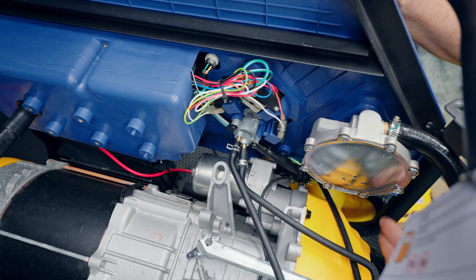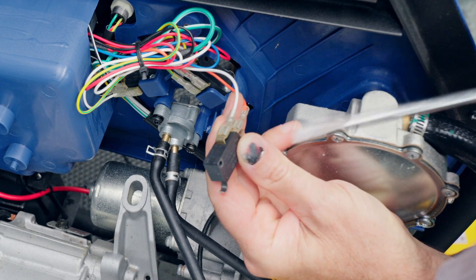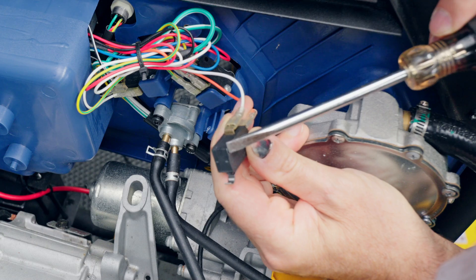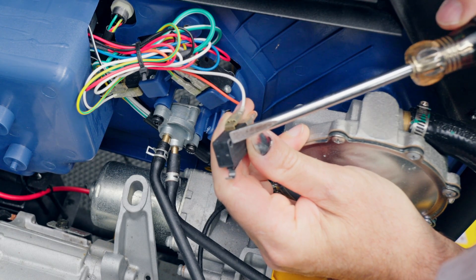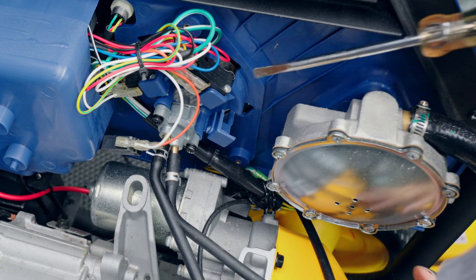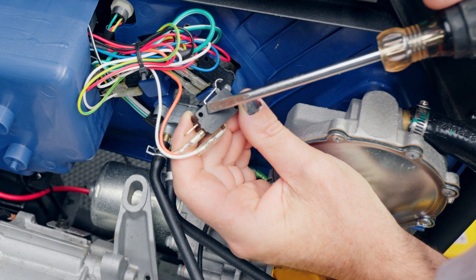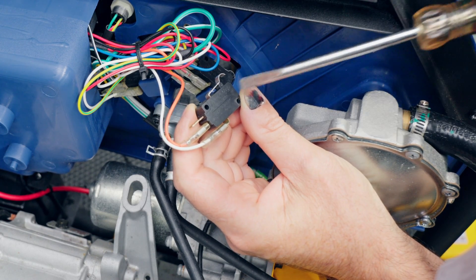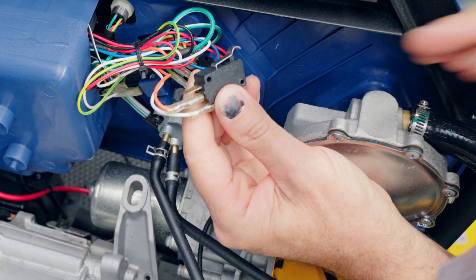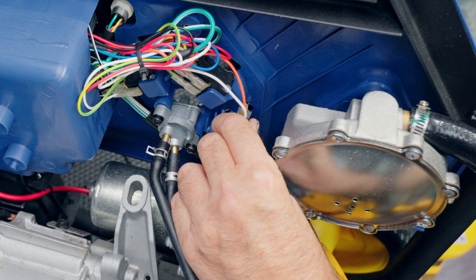This is kind of a flimsy design. Here's the problem — the switch came loose. It's held on by a screw going through an ear in the corner, and all the tension is put on that one corner. That corner can break off, causing the switch to be loose. There's a number on the switch — it says DV16 — so you might be able to source a replacement switch if you can't get one from the manufacturer. I've even seen these switches in microwave doors. Just put it back and that solves the problem.